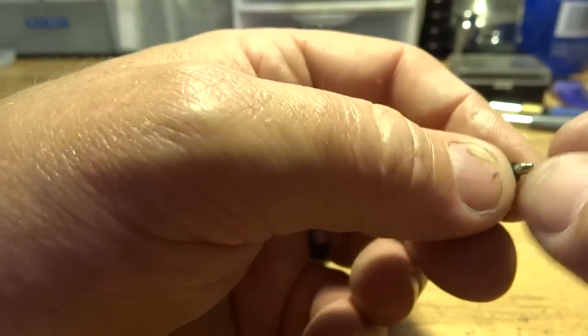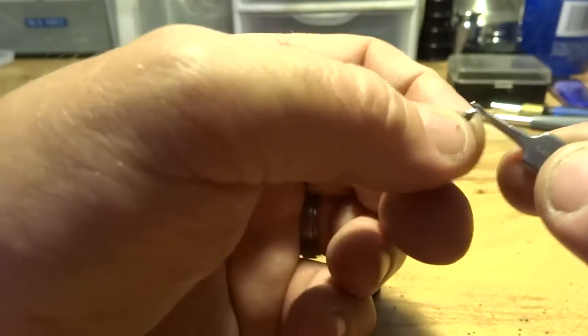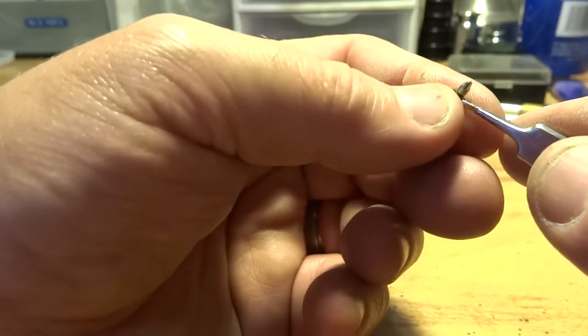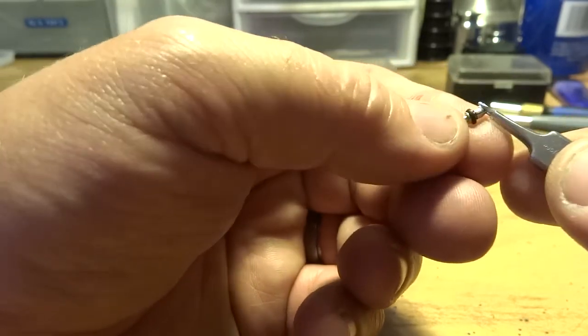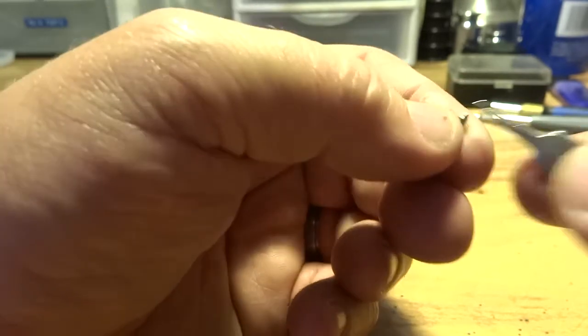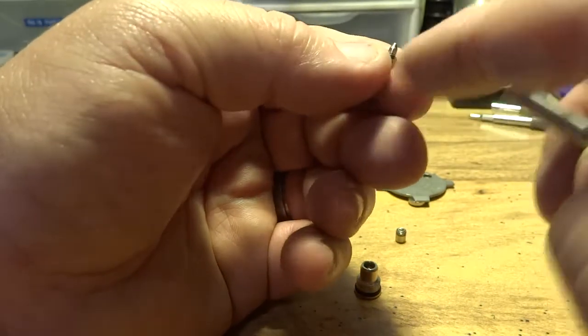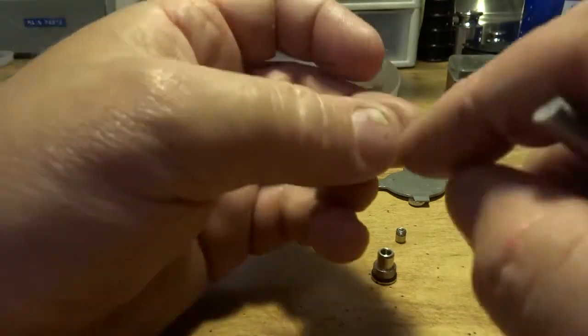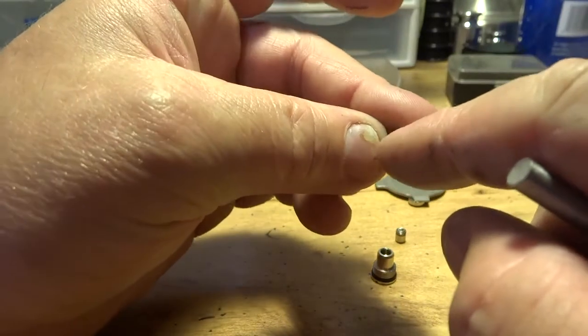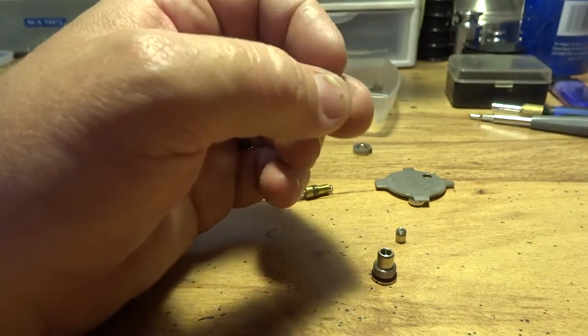this O-ring here. Sometimes you can use an O-ring on here, if you find one. If you take this out and yours is really dried up, you're just going to have to make a new one, unless you can find an O-ring that'll fit that size. A lot of times you can't, and you just have to get some more of these leather punches. You have to measure the outside diameter of the original O-ring that's in it, and then take the one off and measure the inside post, and you're going to cut out the appropriate O-ring out of some silicone rubber.